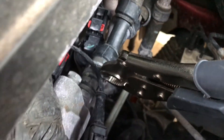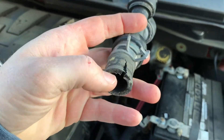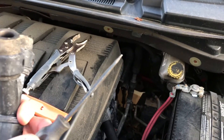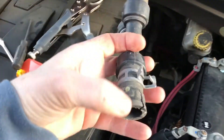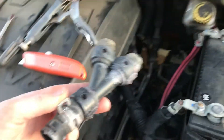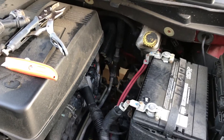It's pretty tight and kind of hard to get off, so it takes a little bit of elbow grease. I found a much easier way than what I was trying to do with prying the screwdriver under. What I did was pry this little screwdriver — much smaller one — under the edge just enough so that it was lifted a little bit. Then I took my box cutter, my utility knife, and just sliced that a little bit and the whole thing just popped right off. It was so much easier. So now this piece is off. You can see I've cut the hoses and there's the pipe it was attached to. A little bit of coolant comes out but that's not a problem — I put cardboard underneath the car because it was leaking already.